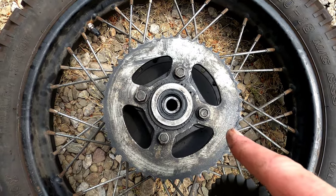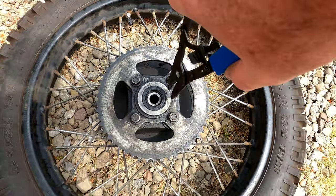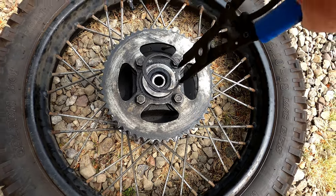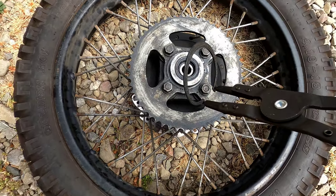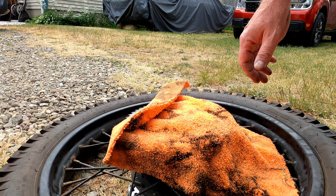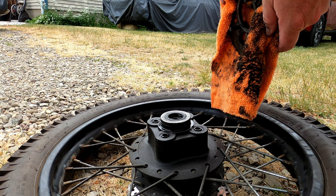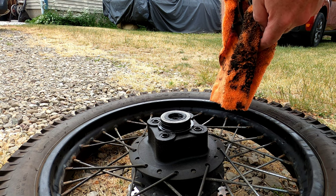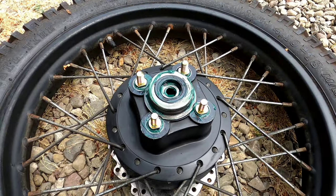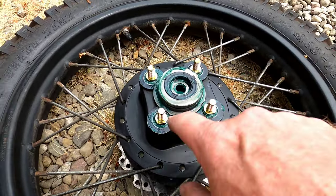What we have to do is take this clip off — this is actually what holds the whole sprocket on, not the bolts. That's why we're replacing the bolts at the same time. I'm using Harbor Freight clip removers, sticking them in the hole and trying to do this with one hand without losing the clip. That clip is basically what holds your sprocket on. That was a piece of cake — a lot easier than trying to take the nuts off, which can screw up your bushings.